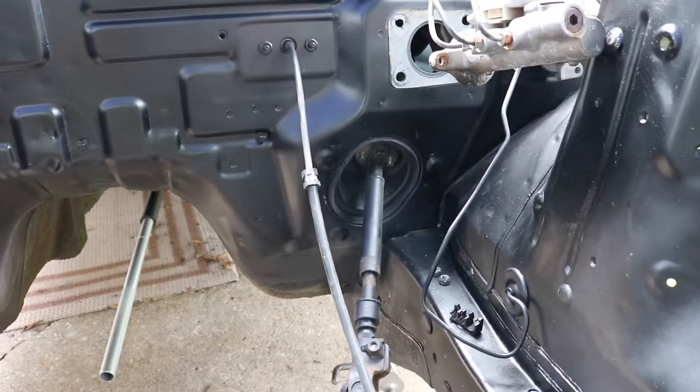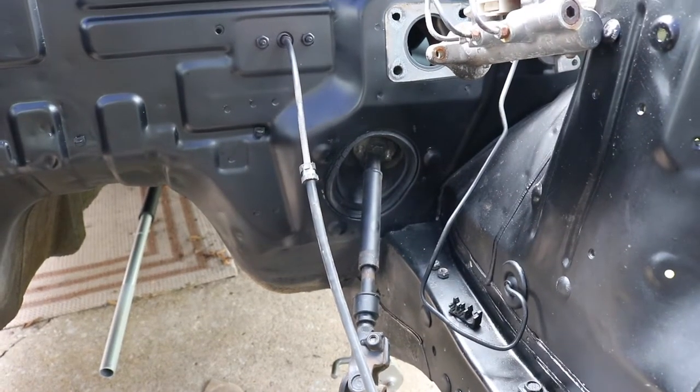Before I put those brackets back on for the steering rack, we're going to go ahead and install these ISR tie rods. These use S14 end links, which I think are a little beefier and maybe a little longer as well. These are brand new tie rods I got used for a good deal. They can give you a bit more steering angle by use of this little gold ring on top which slips on and off. I'm going to run it and see what it's like.